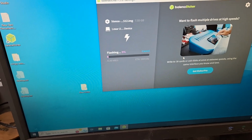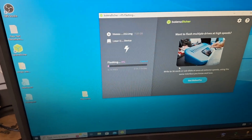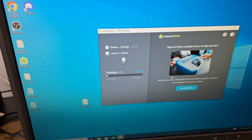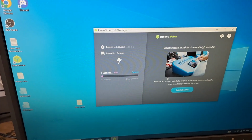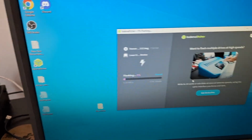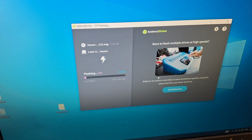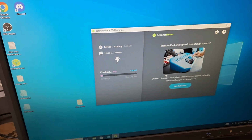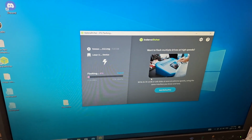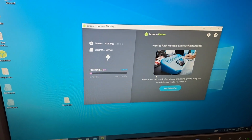Okay, so right now I am flashing HiveOS onto a USB drive. I'm really hoping that on boot up it just goes straight into the USB drive. It promises an Intel Xeon, and I think a lot of the X boards will automatically just boot into the USB drive. So that's what I'm hoping. And yeah, if it works, I will take you on to the next step.